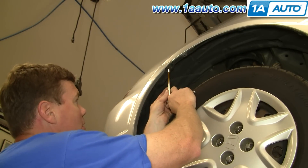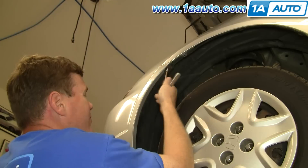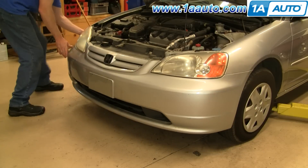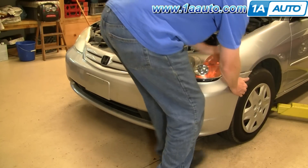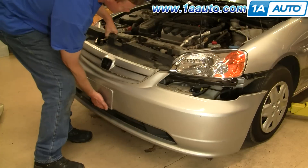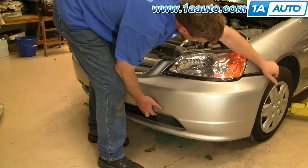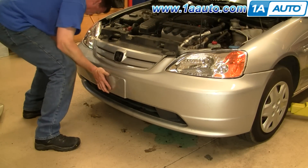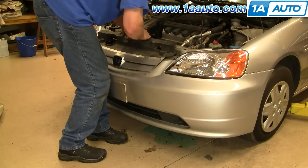On each side there's an 8mm bolt right up here over the front wheel. Now I'm taking the bolt out on the side, and also out from the headlight. The whole operation comes right out. Just make sure you feed it underneath the headlights. I've got a couple of my clips here — make sure you're just underneath.